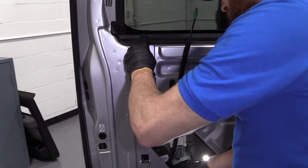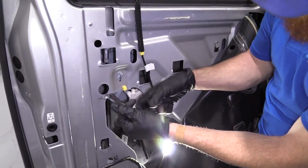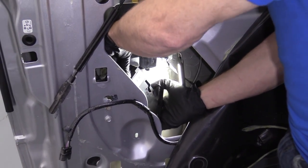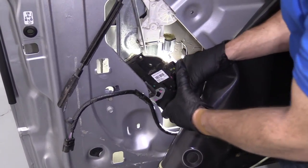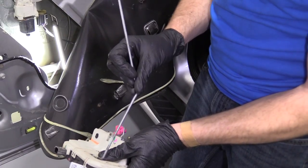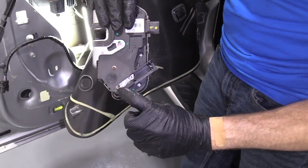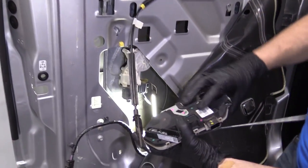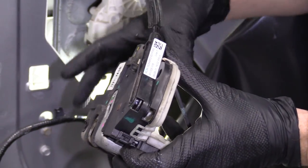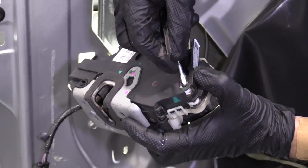I'm going to try to get the whole arm right down and out. Here's our cable — it's just a little scoopy thing and it slides right into there. Just trying to work it around — sometimes you have minimal room in areas like this. So now we've got to get this off: go like this and then out, goes right into this top hole. So when I go to install my new latch, this is exactly what we're going to do — I'm going to be in the door doing it. When I removed it, I just slid it right out.